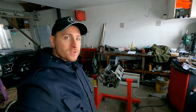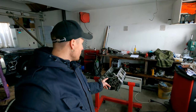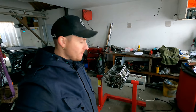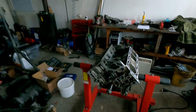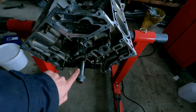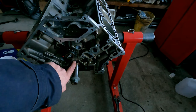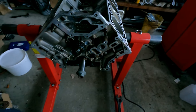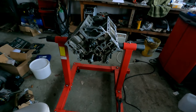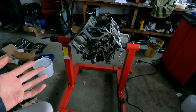So all the measurements are done on the engine. I will put the crankshaft on 40 degrees. That's the position that you need to have to put the cylinder heads on it. When I put the chain on it, I cannot turn it over because otherwise everything drops. The position for that is that the key needs to be centered. So I will put the pulley on, then you can see it because the line is just centered on the timing cover. I will do that, then flip over the engine because otherwise you cannot install the chain. It's because otherwise it will drop.